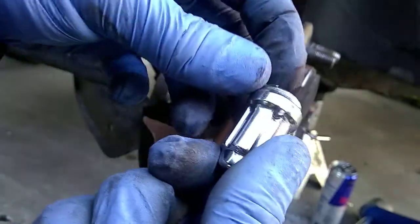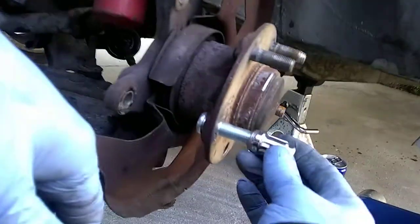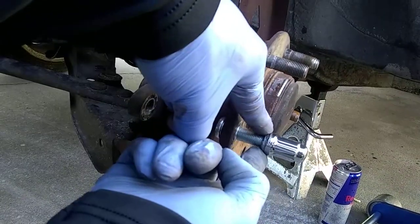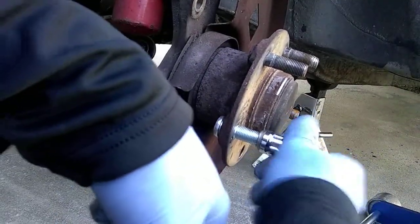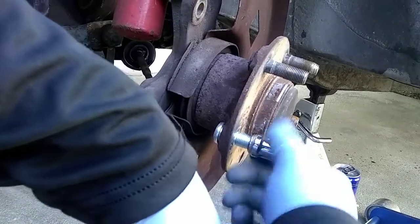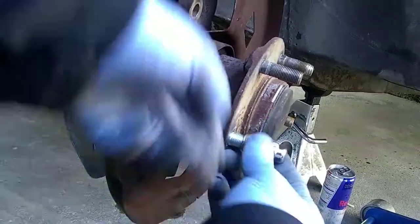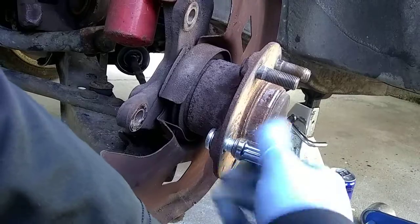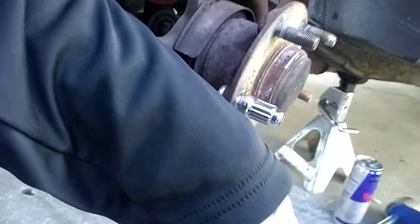You see that little bit of carnage there — take that debris off. When you put the wheel on, what's going to happen is it's going to stud this all the way. Why you need something that comes at least to here is so you don't end up messing up the thread at the end itself. But this is going to bottom out. It'll work better if you have an open end lug nut so it can go all the way down. This is going to bottom out about here because the rim is going to put more of a gap on it. And we're going to try it — we need just a little bit more.